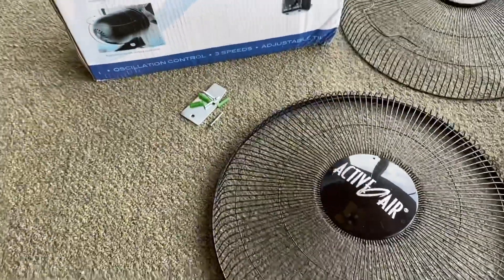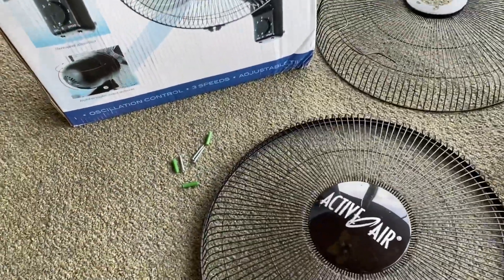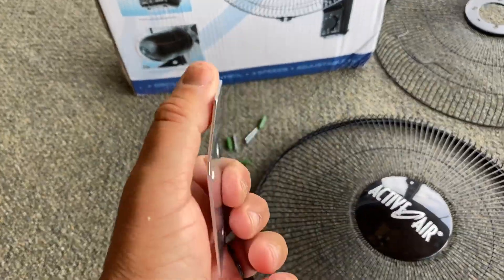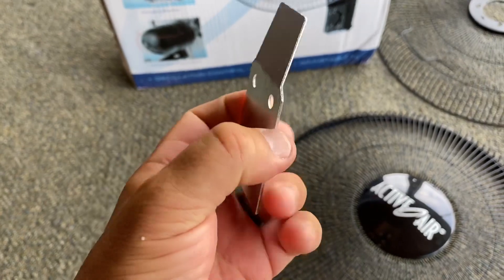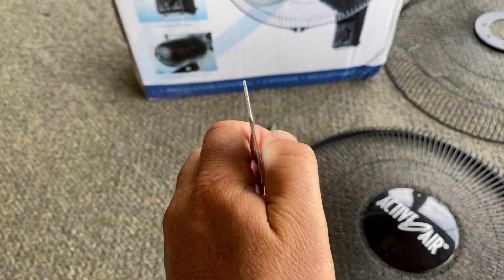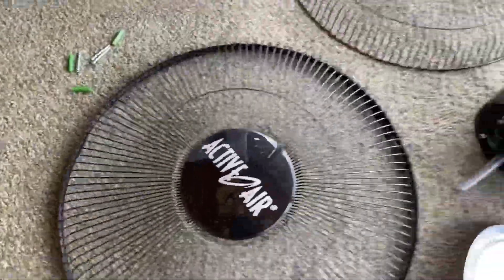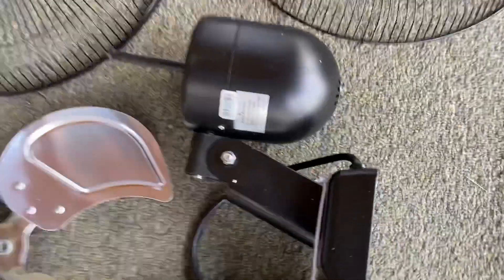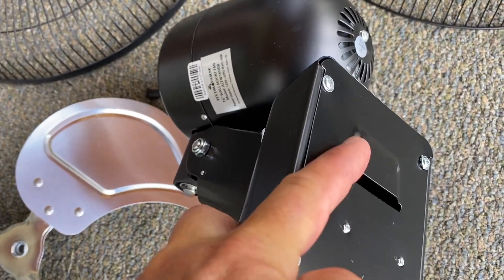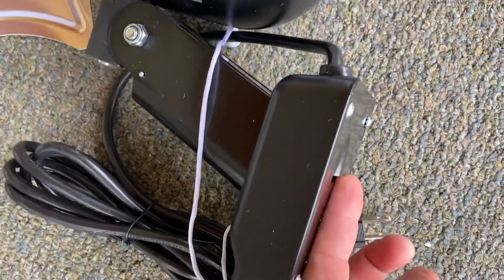This little silver piece here is the mounting bracket. They do give you screws and anchors if you're going to put it into drywall. It's got this curved slot at the top, and the way you mount it — if my finger is the wall — you want the curve to go out a little bit. On the back of the fan motor, right there is that slot, and that aluminum plate simply slides right in there. Then there are two feet on the back that rest it, so it essentially just hangs on that post.